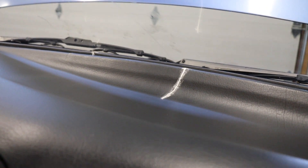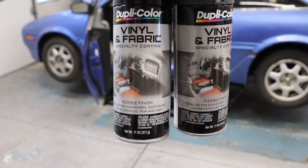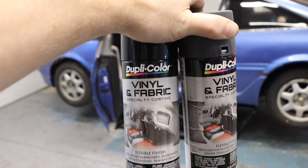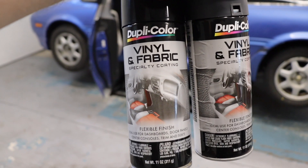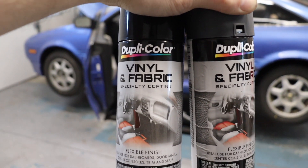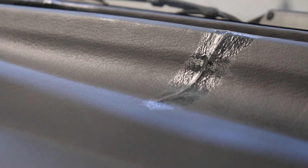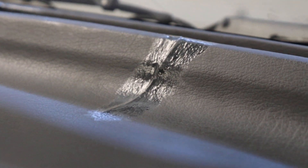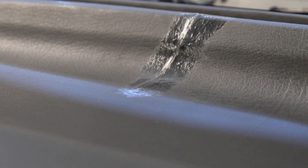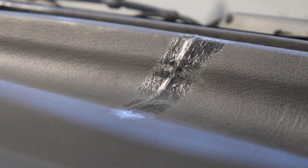Now it's time to get some paint on there and kind of blend it in as best we can. This thing won't disappear, but we can make it look a little better. We're going to grab these cans of vinyl and fabric spray — one's gloss, one's more of a matte finish — and that should balance out to kind of a semi-sheen like you get on an interior like the dash of the NX. We've got a medium gray and a gloss black. I'm going to spray those into the same container, mix them up, brush them on with a hand brush, and get as close as we can. Now obviously it looks way worse than before, but we got the paint color pretty dang good — only took about five or six tries. You're still going to see a little bit of that line because we didn't fully sand everything down. I'm going to let that paint dry, then hit it with some 800-grit sandpaper to dull it a little bit and blend it into the surrounding. But as you can see, there isn't really a crack there anymore.